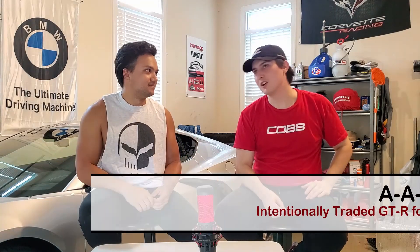A cool thing about this car is it comes from the factory with fully adjustable suspension. That's a known feature on most Corvettes. A little bit of a change though is because the engine is now in the back, we don't have any more leaf springs back there. So we actually got full coils in all corners, which is gonna make it super easy to corner balance. That's a big feature of full coilover suspension — you can actually adjust the individual corner weights, which helps your car handle better.